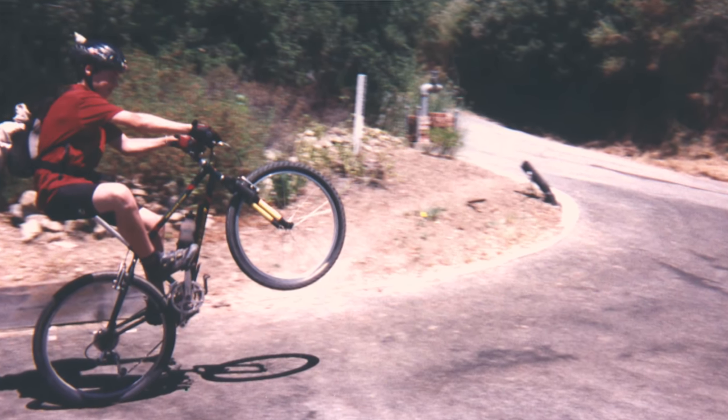As I was editing my about-me bio video, I started to think back to one of my first really nice bikes — my old Bontrager Privateer Comp around 1998, running 1.9 tires. I came from a BMX racing background where we always ran 75 to 100 PSI. On my first real mountain bike I carried that same perspective that more air would be better, so I always rode with really high pressure in those skinny tires. I wish someone had guided me toward a more reasonable tire pressure.